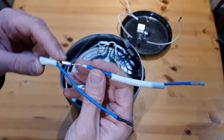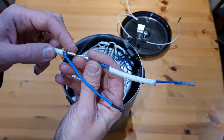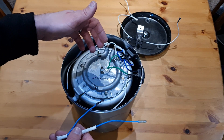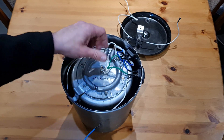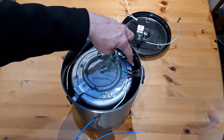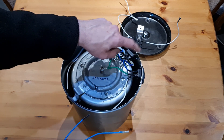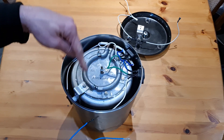What this thermal fuse does is trip and break — like an ordinary fuse in a plug — if the temperature exceeds 157 degrees Celsius. The idea is that if there's an issue with the unit and wiring is getting a kind of safe short circuit or drawing too much electricity, and your consumer unit isn't tripping because technically it's within safe range, the wires could heat up and get very dangerous. The thermal fuse will trip if it goes over 10 amps or over 157 degrees Celsius.